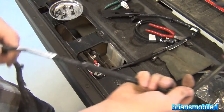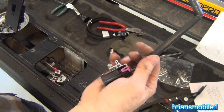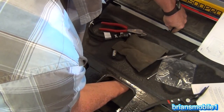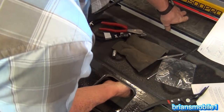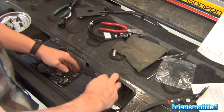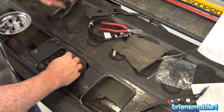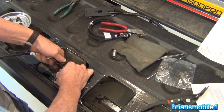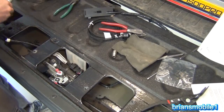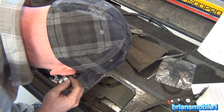That went to the tailgate lock — so this is the whole mess from your tailgate. Start with your purple plug, watch out for these guys, go sideways and just tuck it through. This one's a lot stiffer than the one that came out of it because there's more wires — you've got all the wires for the camera. And when things are factory and everything's designed to go together and you don't have to invent it as you go, it's pretty nice.